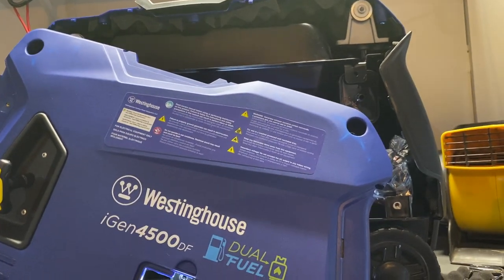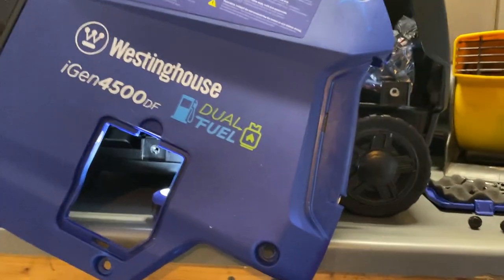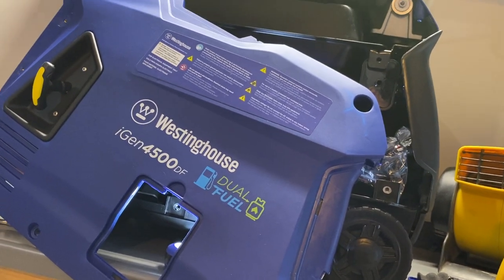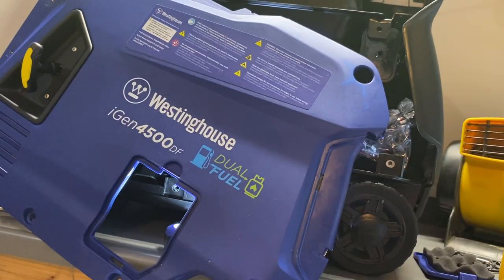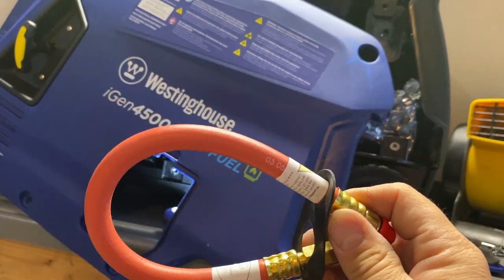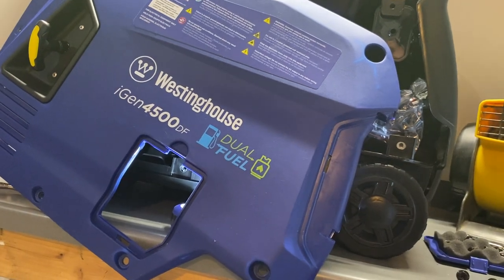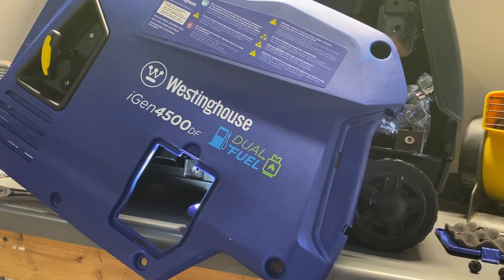It's easier for me to remove this cover and have all the clearance I need because I'm actually putting on a Drainzit right now — that's one reason I have this open. I haven't started this up yet, so I'm doing all the fixes. I put in a high altitude jet kit because I'm in Colorado, above 6,000 feet, so I re-jetted it before even running it. I'm also putting on a Drainzit on my oil drain — I believe the model number is HON-10-10 — I got it off eBay for about 25 to 30 bucks. There are some videos about the Drainzit if you have questions.